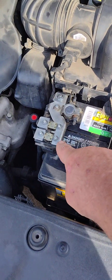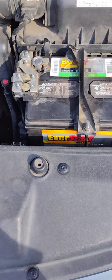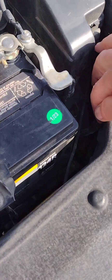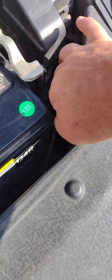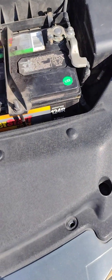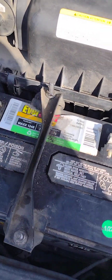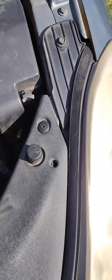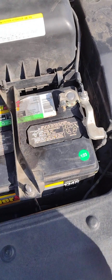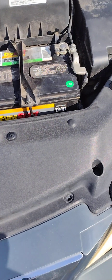There's got to be a reason why this car is eating alternators. What I'm going to do today — I've already cleaned the positive 12-volt connections to the battery, so I believe that side is good. Now I'm going to focus on the grounds. The first one I'll look at is right here — the one that connects to the radiator support. I'll also get under the car and look for any other ground connections I can clean up. A bad connection to ground could be causing this.